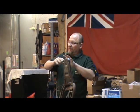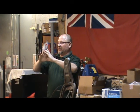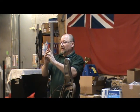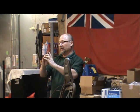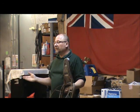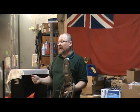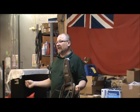After that, you want to feather out with some water, get in there, wet it. Now you don't want a wet ring with a solid edge. Just take a towel and make bigger and bigger wipes on it. So basically you're stepping down that stain or the wet area out until pretty much to nothing, so your eye doesn't go directly to that circle. You want to maybe try that a couple of times if you're having a stain. Try and determine whether the stain could be water soluble, or if it's a grease stain, you're going to have to go in with a little bit heavier solvent type. But you can always call somebody to help you out. You can call here. You can ask me.